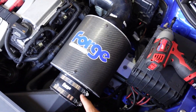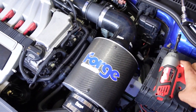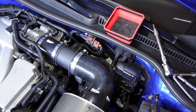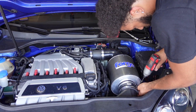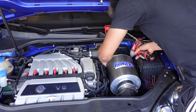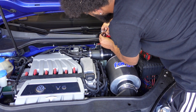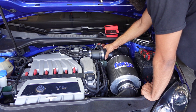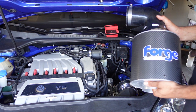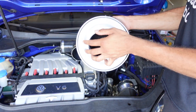Got tools here. I might have to take the scoop off, maybe sneak it out. I got a 7mm socket right there, and I think a 6 or 5mm Allen for that clamp. I'm going to hop to it. It comes out just like that. Just squeeze off the elbow. Now we can attack the filter itself.